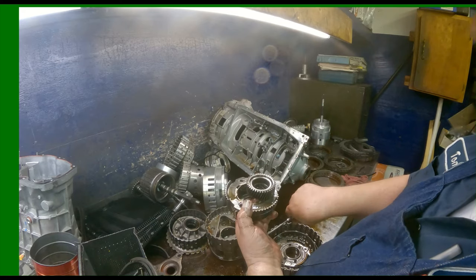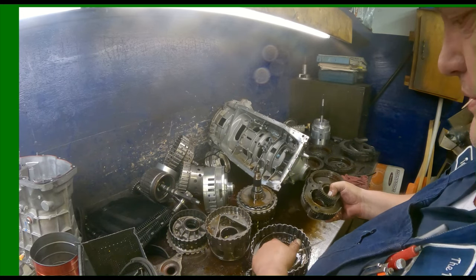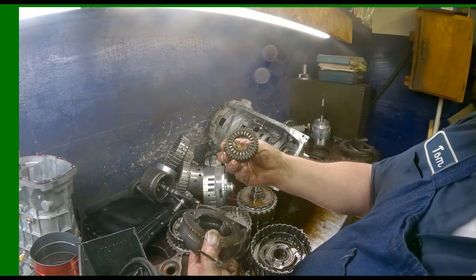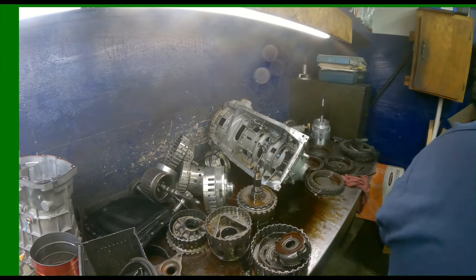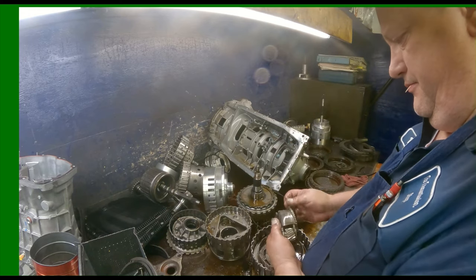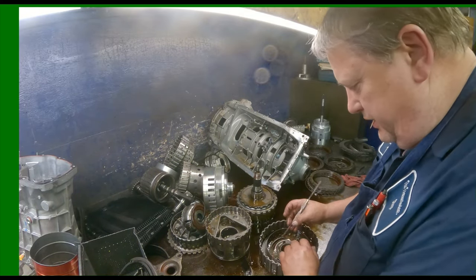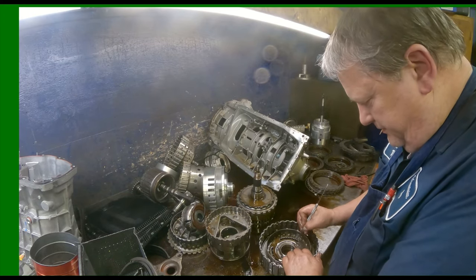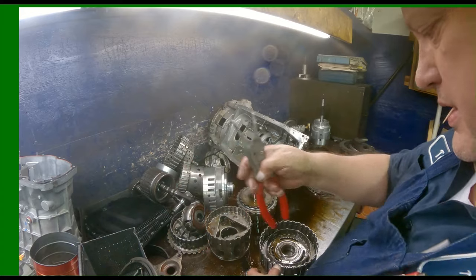You're coming in right through there. I'm pushing the snap ring off these little tabs down here. Sun gear with the bearing in the back, race in the front. Nothing here. Be careful and don't screw that up. This has to line up a certain way, so I just scribe marks where the little tabs are sitting. And you'll need a pair of snap ring pliers like that.